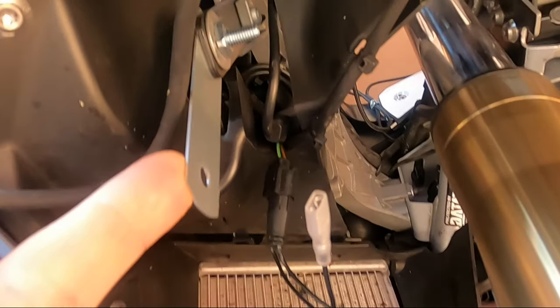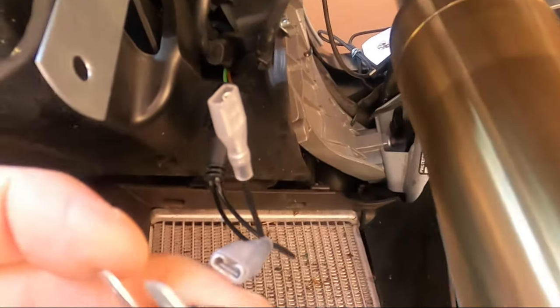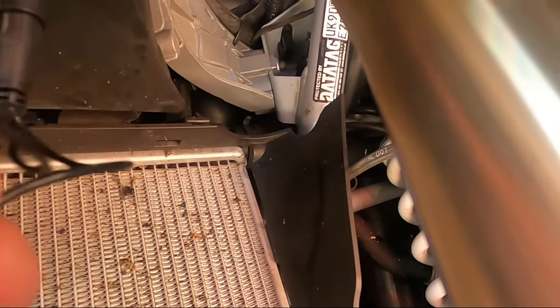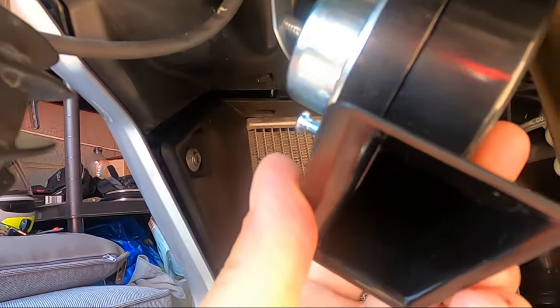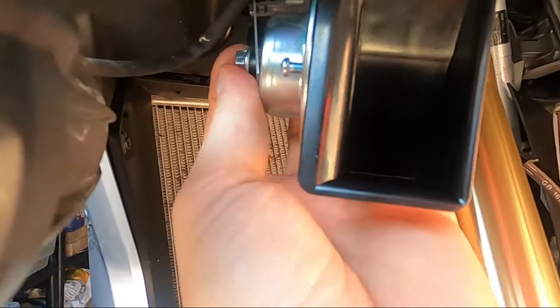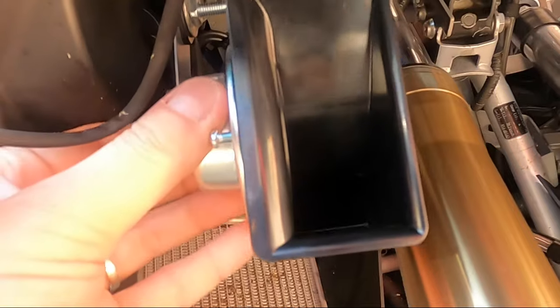With the wiring adapter now in, I've bolted the extended bracket on there as you can see. I'll now put the connectors — I call them crocodile sliders — push that into that. Those are now on. I'm going to push the horn into the hole in the bracket, put the bolt in there and whip that up to the bottom of the bracket so it's nice and tight. Tightening the one at the top as well — that could do with being a little bit tighter.